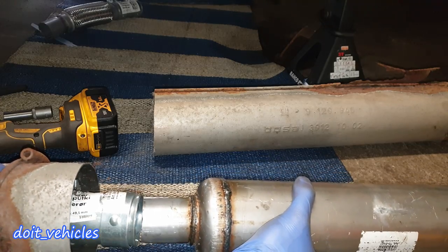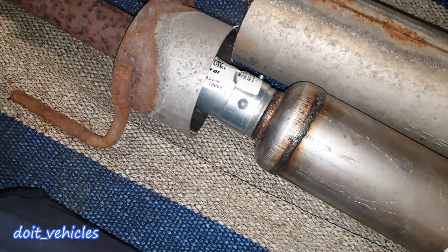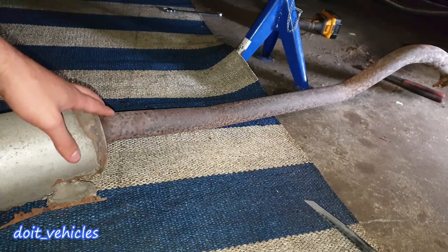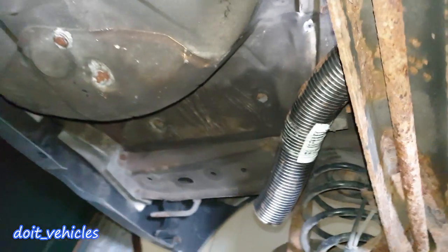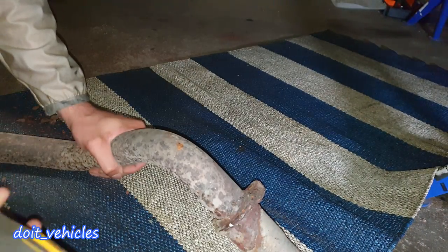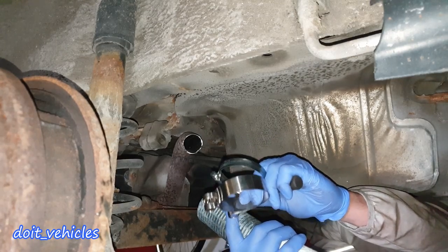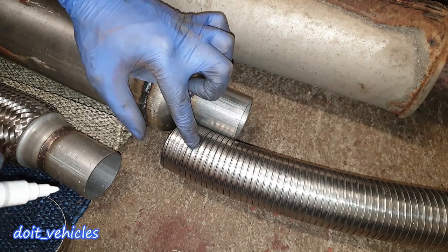I place the new sound diffuser and tie it in, then cut it to size. I have to use a hard pipe to install the exhaust on those curves, because the flexible exhaust will always touch other parts and that's not good. I also found stronger clamps to give a better contact on the sound diffuser pipe, and I cut the rusty end a little bit.